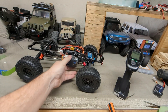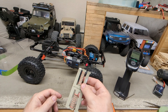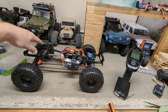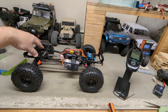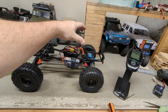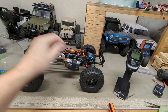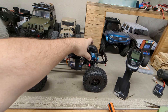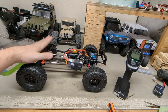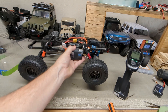We've got the soft springs on the front and the firm ones on the rear. I do have the medium ones that I can put on the back if I want — it's sitting up a little higher and I'd like it lower, so I may change to the medium springs to see if it'll ride lower. The front seems to be compressing pretty good on its own, and these are brand new so they should soften up a little bit as they get used. I may switch to the medium springs and when they break in go back to the firm springs.